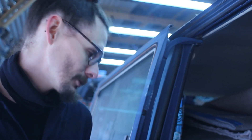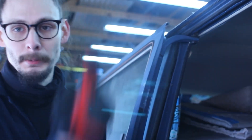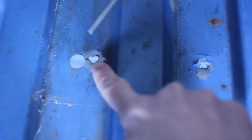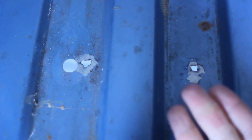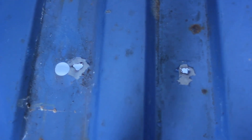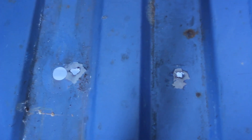We don't have a way to do that easily because you can't see where the spot welds are from underneath, so we drilled the spot welds from the top down so we can ride the nibber up from the bottom. We'll back it with a piece of copper so that the weld doesn't fall through the hole, fill it up with weld, and then grind it smooth.